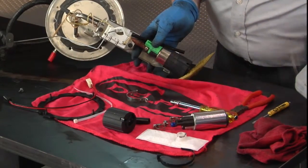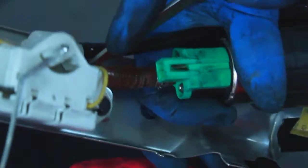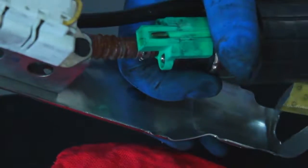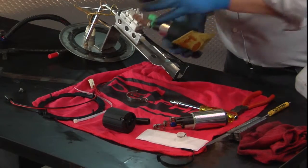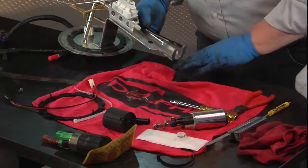I'm going to take a pocket knife, being very careful not to cut myself, and do a little surgery on the hose — careful not to cut into the plastic of the hanger assembly component. Now the pump is removed. So we have the pump, hose, and strainer. We'll set that aside, and now it's time for reassembly.